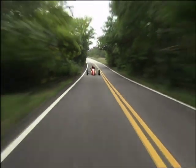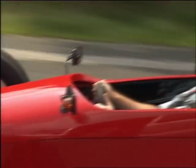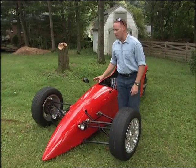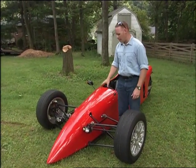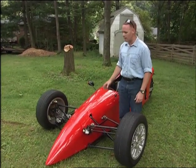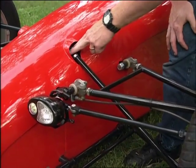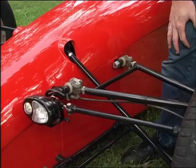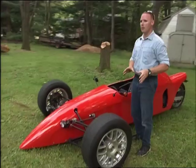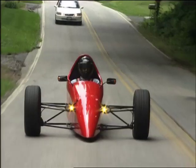Safe — not only because Jameson never intends to race his IndyCycle, but because this is a motorcycle with an extra wheel, and that's only the beginning. The IndyCycle has a chromoly frame with a fiberglass body on top and aluminum side panels on the sides. The front suspension uses a push rod to go to a rocker arm and then to the shock absorbers. The wheels are exposed and, according to both Maryland and Virginia state law, do not require fenders.